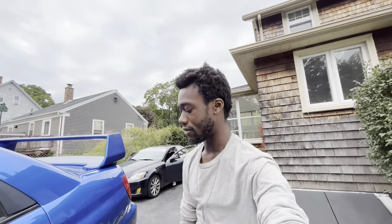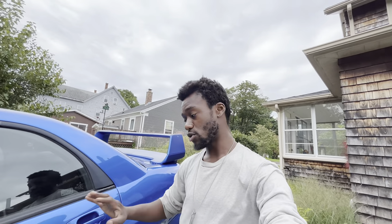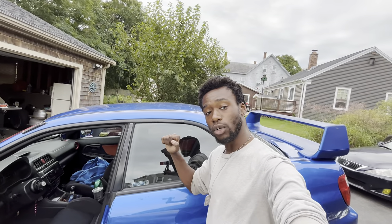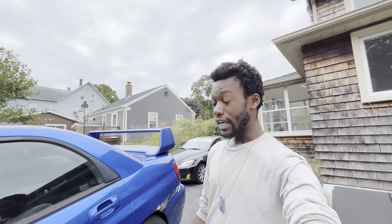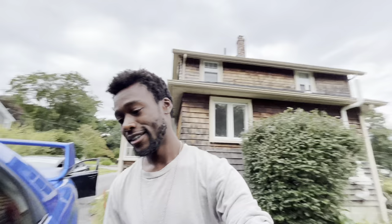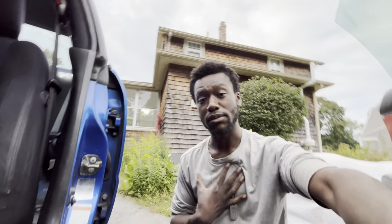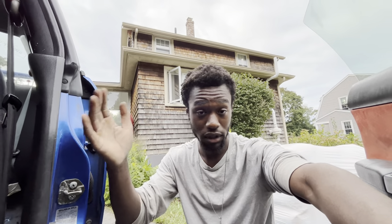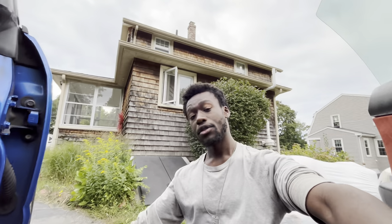Easy fix. I just procrastinated for a long time and overthought it, because I thought it was going to be way more of a process than it actually was. It was super easy. All I did was undo my back seat, pull out the little grommet, and cut the metal line to replace it with a rubber one. We're good. And I'm running on all four cylinders — not just three — because my dumb ass actually checked to make sure all my injectors were plugged in before I started. Essentially that was really all I had for you guys in this video — just a quick little helper for people who have weird niche problems like that and don't have the time to look on forums because they have really bad ADHD. This video is for you guys.